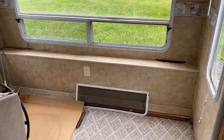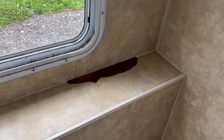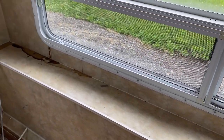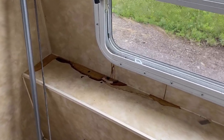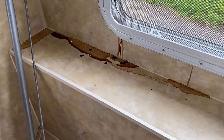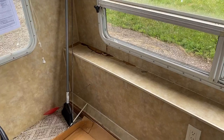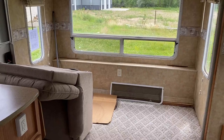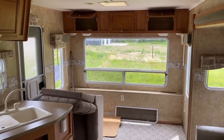I also noticed you might see little pools of adhesive — that's kind of what we're looking at right here. I think that came in from the windows. We got some nasty weather last night — we had a tornado actually touch down not too far from this facility. It's possible that just some rain blew through there, but some of that looks a little dried out. When I look at the RV window from the outside, I don't see any leaks or seam failures there, so I'm wondering if a window just didn't get totally shut and it rained sometime.